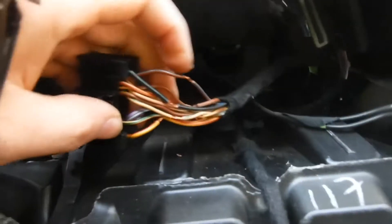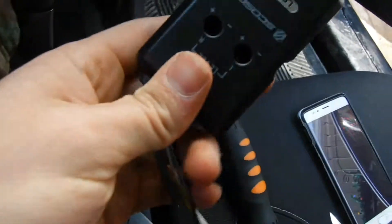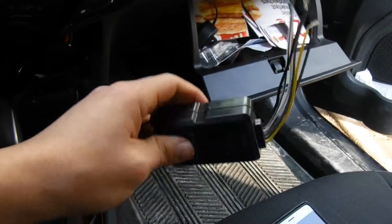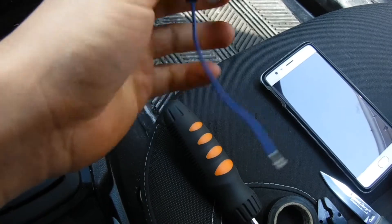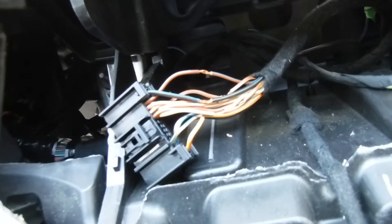It's a painstaking process — my shoulder hurts. But I got most of the wires stripped that I needed. I'm going to wire in the line output converter right now. I'm going to pass the RCA cables through the bottom of there and the remote cable, and just leave it on the floor right there. For the most part, the wiring diagrams I've seen seem to be correct.